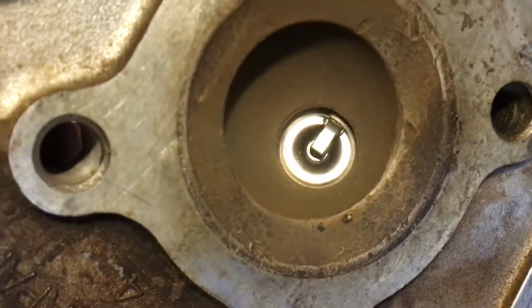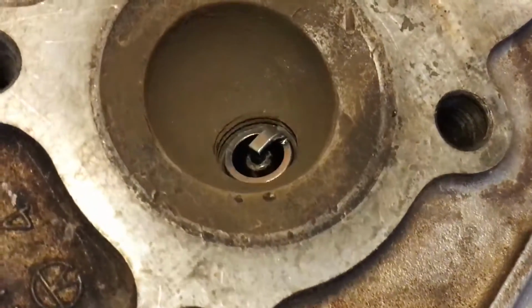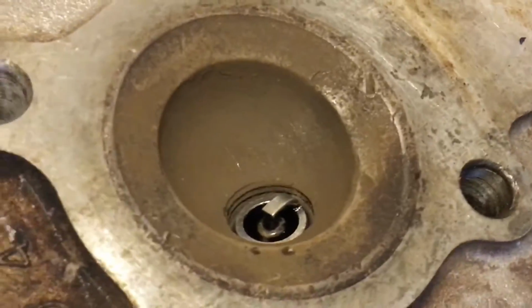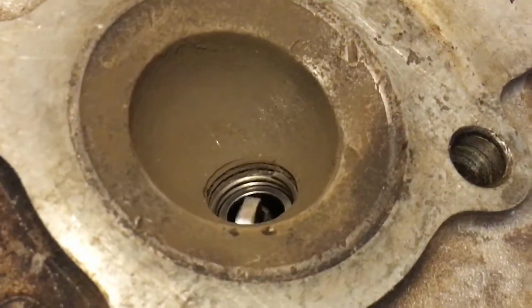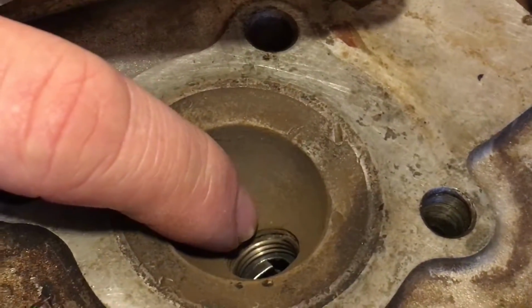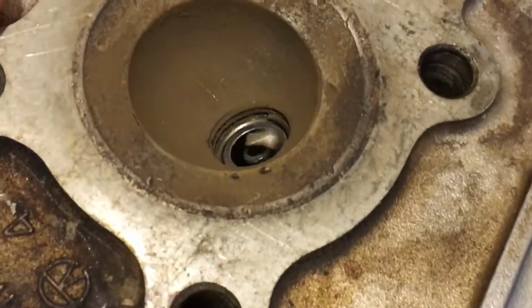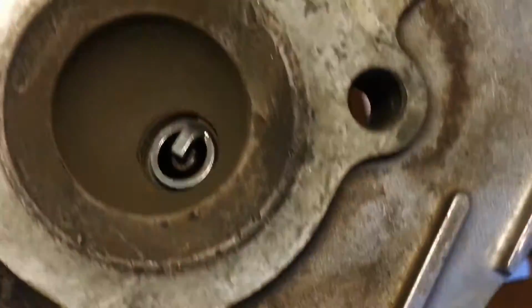That's what it looks like on the back side. But you can see the thread. You can see the bigger threads. See, I'll pull it back so you can see it adjacent to. You can see where it got tapped, right there. The helicoil was put in, and the helicoil reduces it down to the spark plug size. And that's how it looks coming through.